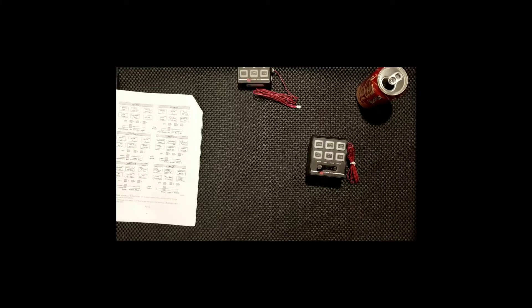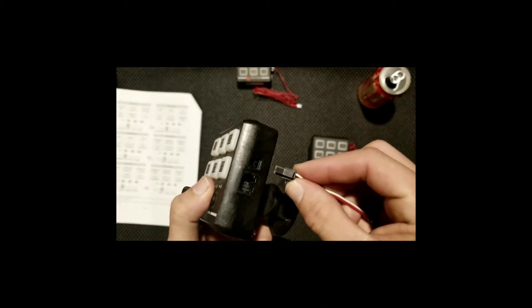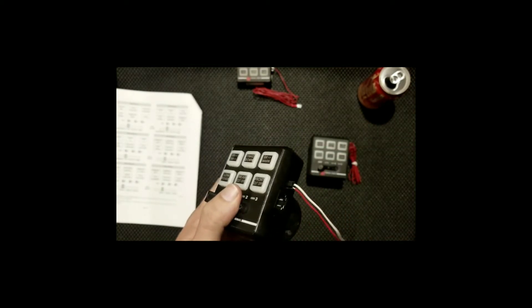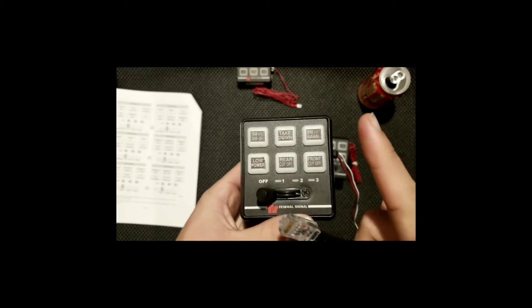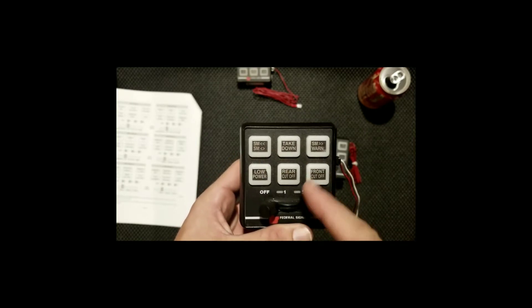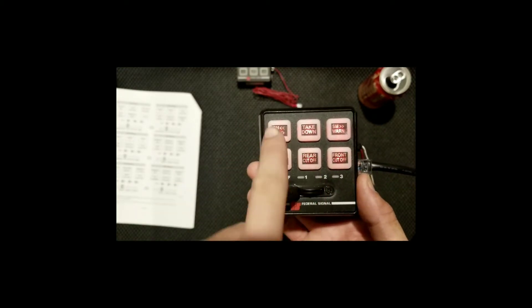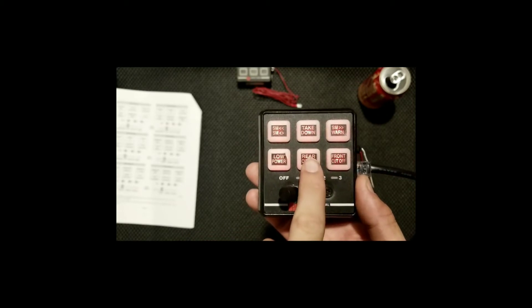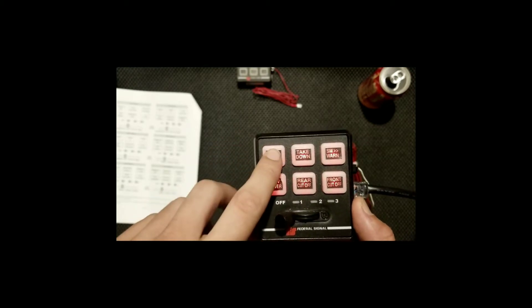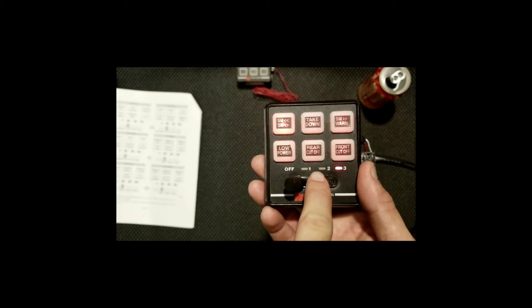Alright, let's get into it. Same light bars in the back. So here are your power connectors — you slide that in, and then your CAT5. Watch carefully: as soon as it powers on it's going to light up and indicate which button is programmed. In this case buttons one through six lit up and number five is illuminated, which tells me keypad number five is programmed.